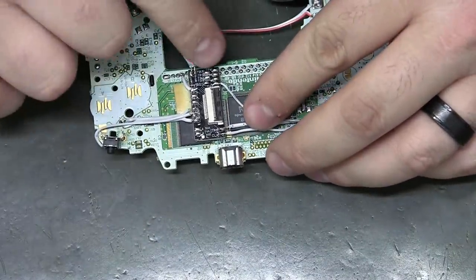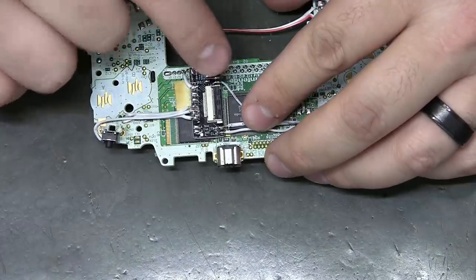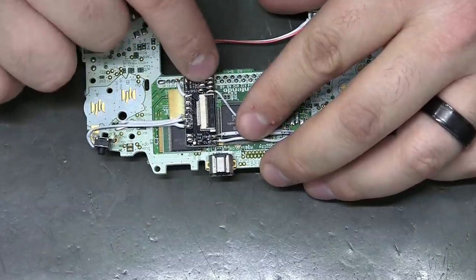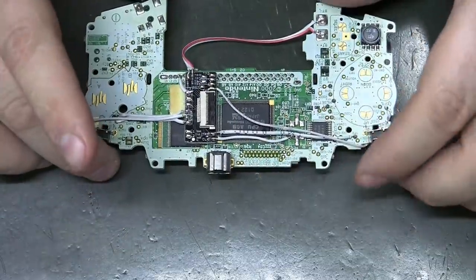The only thing I don't like about these pads being on top of each other like this is it may not be as much of a deal with Kynar wire, but with ribbon cable, if that melts back and gets pushed down, the ones we solder into these places could actually end up touching, shorting. Something you want to avoid, obviously.